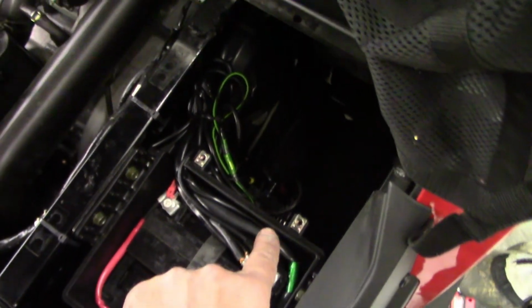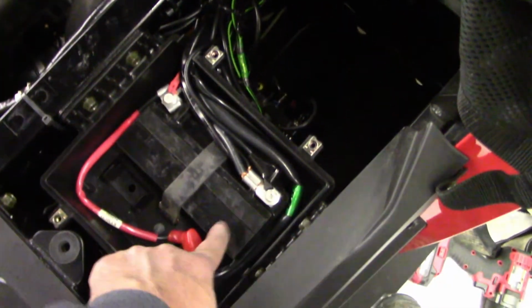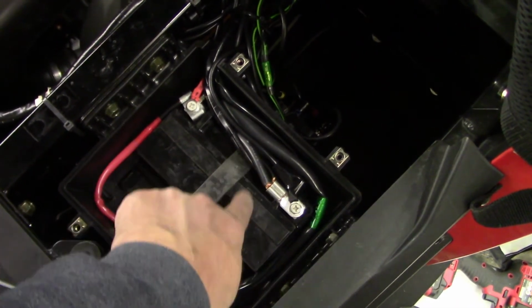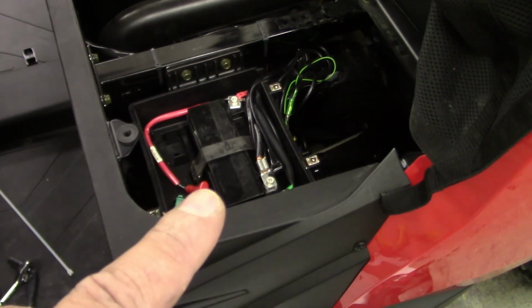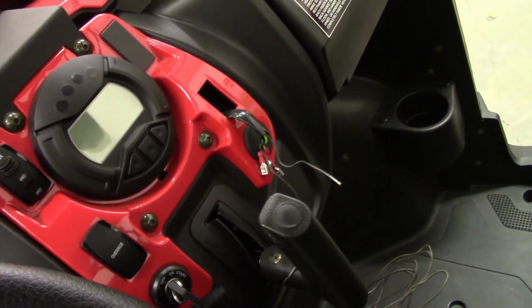And then, of course, there's your battery. I took the battery out and right there is the solenoid, if you can see it. What I did is I got the drill down, and this is big enough to get your drill in, held it up, and popped the holes in. They give you nuts and bolts to mount that, so I put the bolts through the box and the nuts on the outside. There is room, the battery won't hit the bolts, but I did put a couple pieces of foam with adhesive on the side here just so it wouldn't rub the bolts if it was vibrating in there, but that should never be an issue. There's plenty of clearance. So I'm gonna get the top back on the battery box. Then I'm gonna move on to getting the switch wired up and see if I can get it to work. And then I'll check back in.